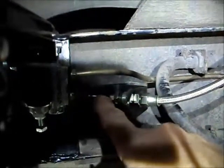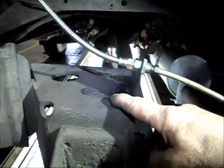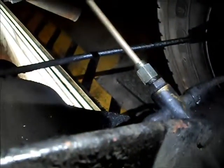Out of the valve comes a little bit of rigid bracket here onto the flexible. This is the flexi hose here, and that comes down, and that's just held with the bulkhead fitting here on a little bracket put on the plate that carries the handbrake actuator. That continues in rigid pipe all the way down to the T-piece on the axle.